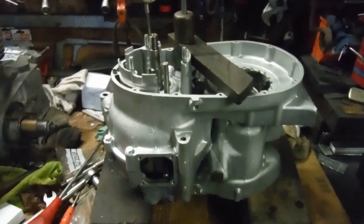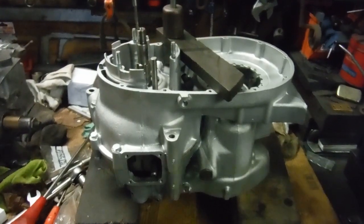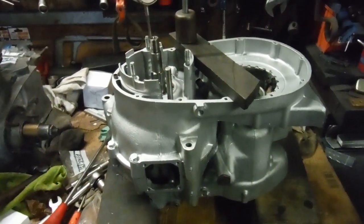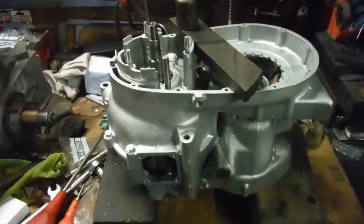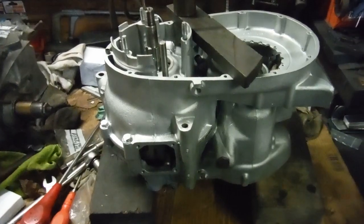This one's not far off, and when it's done I've got another complete A65 engine to strip down and go over. Apparently there was an oil tap fitted to the oil tank, and a relatively new owner of the machine who wasn't used to it forgot to open the oil tap, ran it, and now it's in my workshop awaiting a strip down. More on that soon.